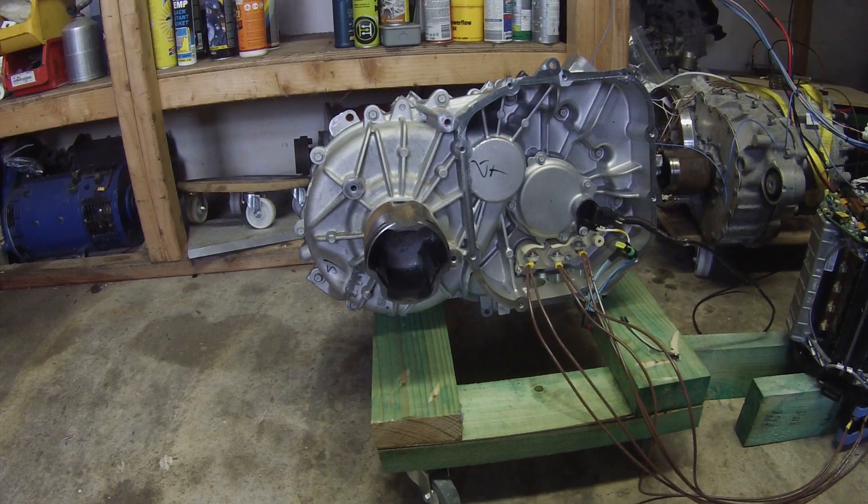Let's have a look. Here we go, bringing on the juice. We are in AB encoder mode. We've got about 45 volts on the DC bus and we're in closed loop. We're now running with the exact same parameter set as the large drive unit motor, including the encoder pulse count, encoder mode, motor poles, voltages, and currents.